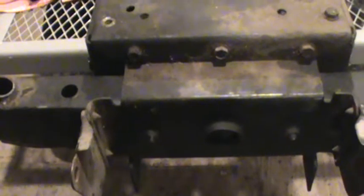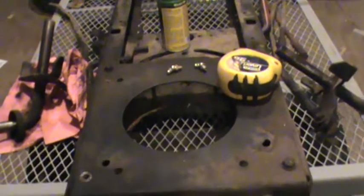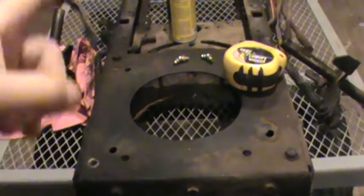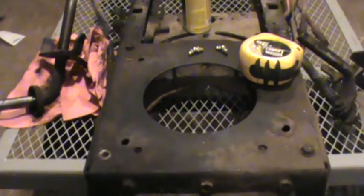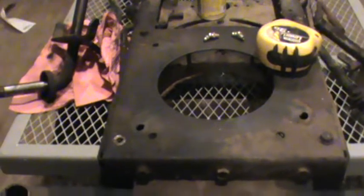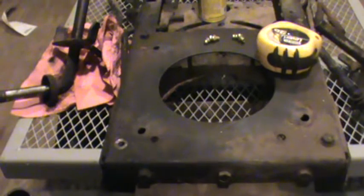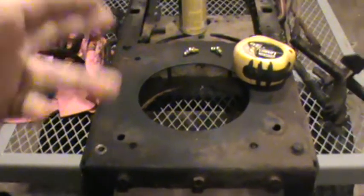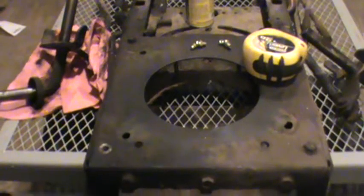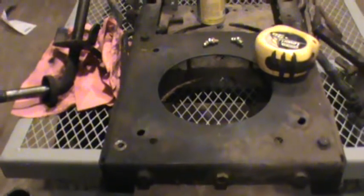It's going to have a double belt system. The clutch will operate off the engine to a jack shaft pulley, and then another pulley will run back to the transmission, and that's just going to have a tensioner pulley on it with a hellacious spring to keep tension there. The clutch will work in the forward area, so that linkage and stuff will be easy to fabricate up.